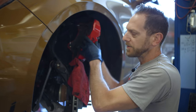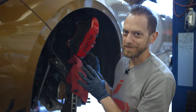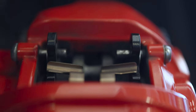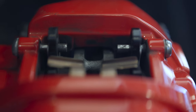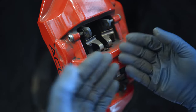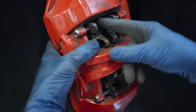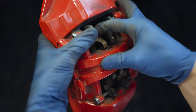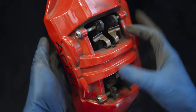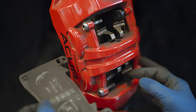This helps the caliper stay steady enough so that you can actually service it. The way the pads are held in — you'll notice the pin doesn't go all the way across, it only comes right out here. Once you have the caliper off the rotor, the only thing really holding the pads in place is these springs against the pins. So you can just slide them right off and then the whole pad comes out.